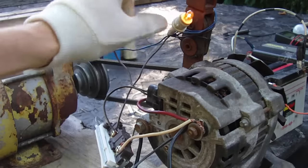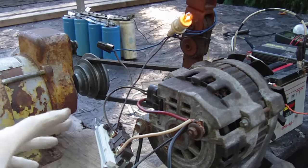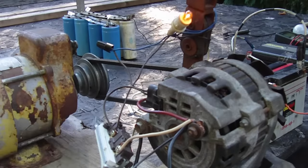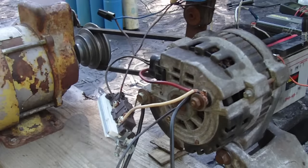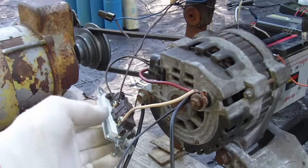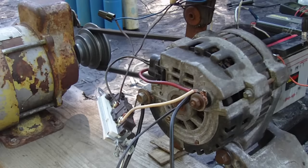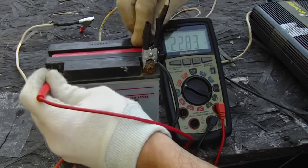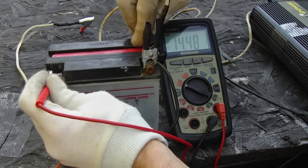Switch the switch on and you'll see the indicator light come on. Once I start this thing, the indicator light should go off. You don't have to start it with this on — you can start it first and then turn this on, so it doesn't really matter. I've got to give it a little bit of a spin because the startup on this motor is not very good. Okay, so there we go, it's running. Now the alternator's not on, but to turn it on, all I have to do is flick on this switch. Now you can hear the difference. We'll check the voltage in the battery — you can see 14.5 volts almost. So it's working just like it would in the car.